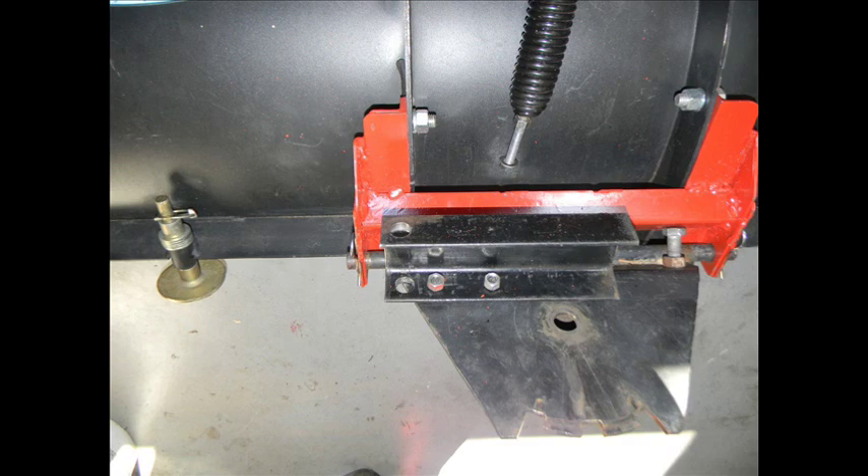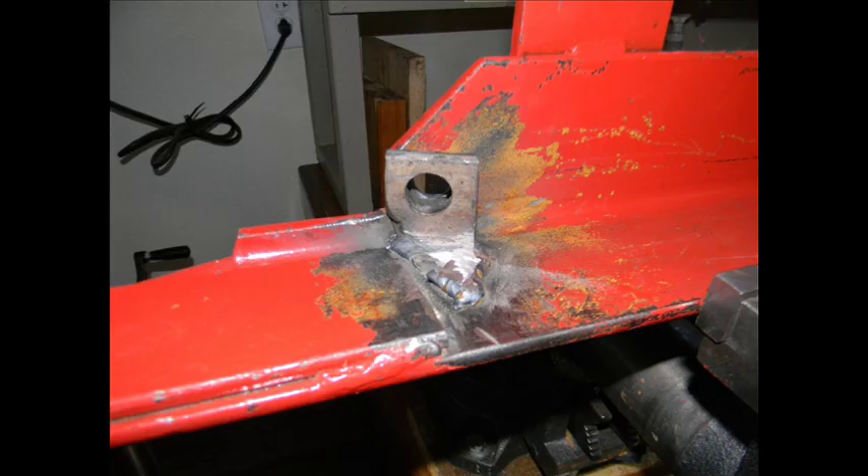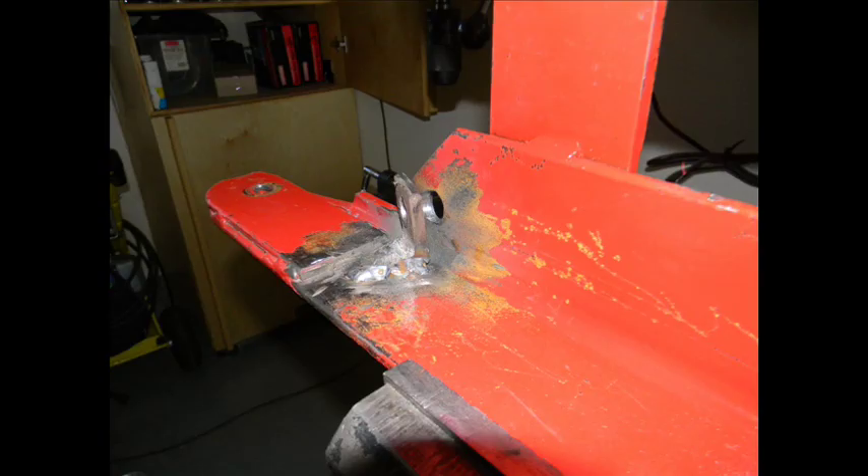The live actuator is fabricated from the original Sears 3-inch channel, which is sturdy enough to handle the forces. Take a look at the 5/8-inch hole through this, which is where the actuator fits. It's somewhat encroached on by the actual frame mount — the bolt holes should be drilled about a half inch further in toward the center to accommodate the pivot. The dead end of the actuator is mounted directly to the fabricated frame, plus a little piece of angle iron. Drill the hole in the frame first, then weld or bolt that piece of angle iron so you have two spaced mounting points for the actuator.